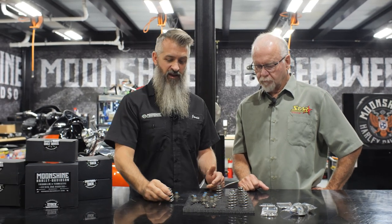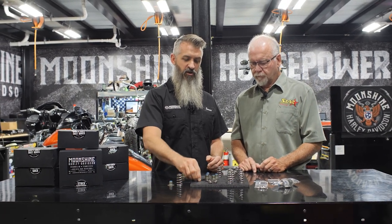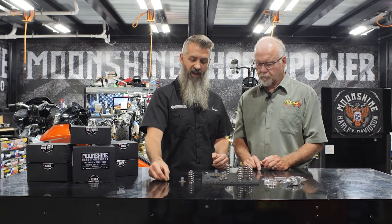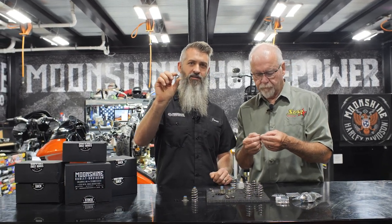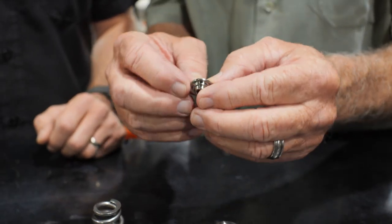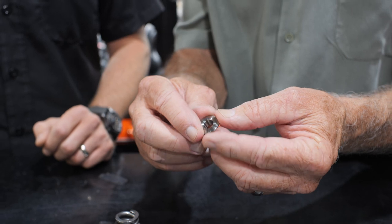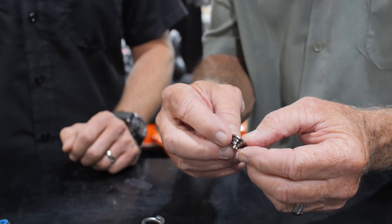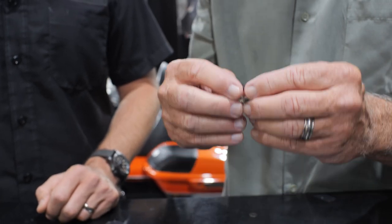You're looking at everything in the kit right here. You get eight springs, eight valve seals, 16 locks, and eight retainers. These are really cool — Star Racing right on them. Titanium retainer designed by Joe Hornick of Joe Hornick Enterprises, with George Bryce's input on what we're using them for and the limits they need to handle. This is also made with serious computational dynamic design — computer generated and tested with no straight edges, no sharp corners. Every single edge is radiused. This is the only retainer I have seen in my 40-year career where every corner is a radius corner, which makes it a really strong part. Can't bend it, can't break it — these are pretty much unbreakable.